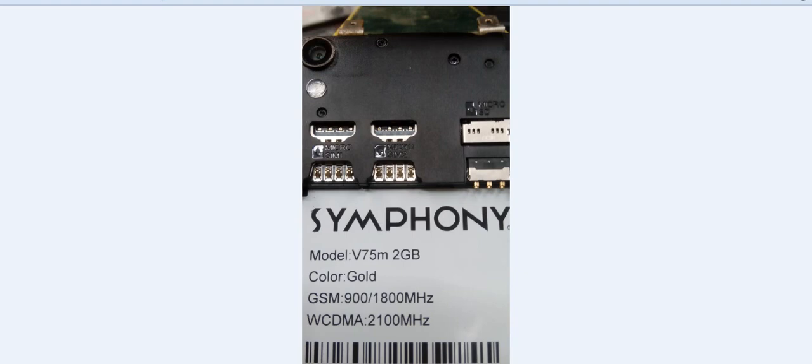For this model there are two kinds of phone: one is 1GB RAM and one is 2GB RAM. If you want to flash your 2GB RAM phone with a file of 1GB RAM, the set will be dead. It will show result failed. After you have flashed it with 1GB RAM, the phone will be dead. Today I am going to show you how to flash your dead phone again and solve this problem.